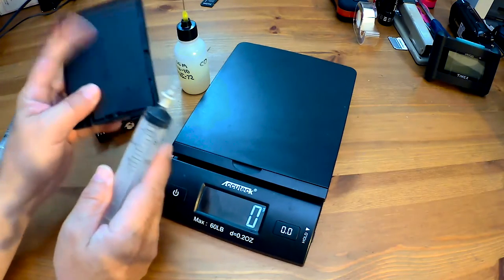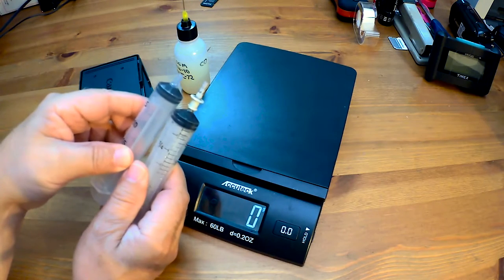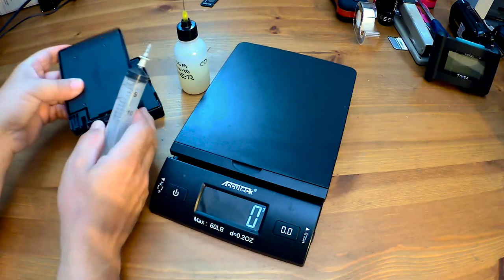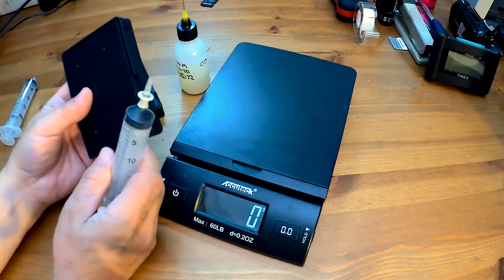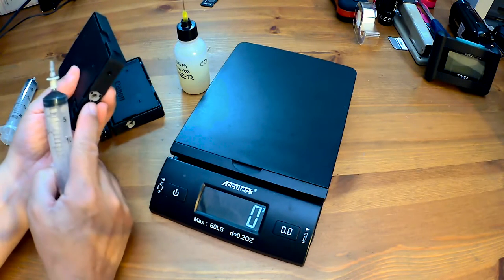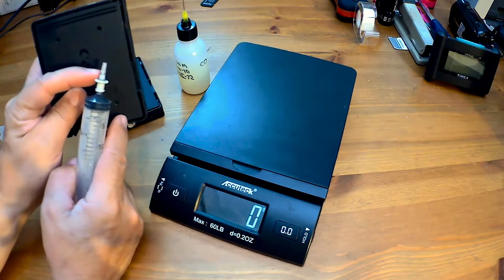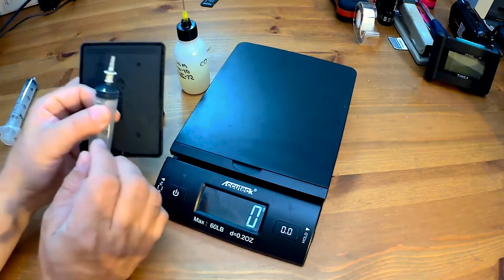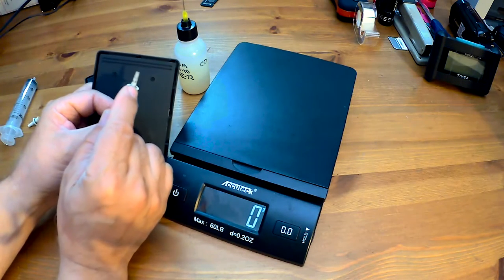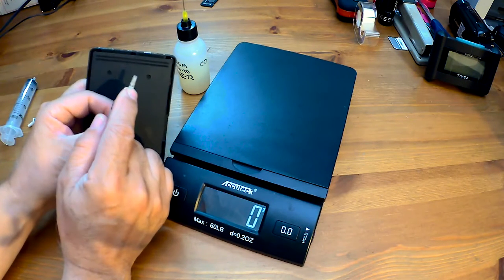The idea is you need to penetrate both ports. To do that, you need a longish type tip — a regular syringe will not reach far enough inside the ink bag. When refilling, you have to make sure that the port in the ink bag — not just the external one — is completely sealed against your refilling tip. I suggest you get a brand new one that is nice and smooth.